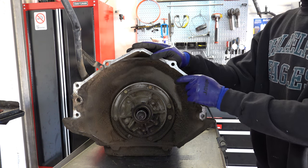And then the other thing you can do, if you can find one, is install a Corvette governor, which has a completely different set of weights on it. In fact, this entire section here is cut out, and it's just skeletonized. That's designed to create later shifts in the RPM curve, so that it'll coincide with the Vette's higher performance engine and higher stall converter that was put in there from the factory. I'll do a separate video on setting up and reconfiguring governors, disassembling them, installing new gears and cleaning them out and all that good stuff. But that should tide you over for now.